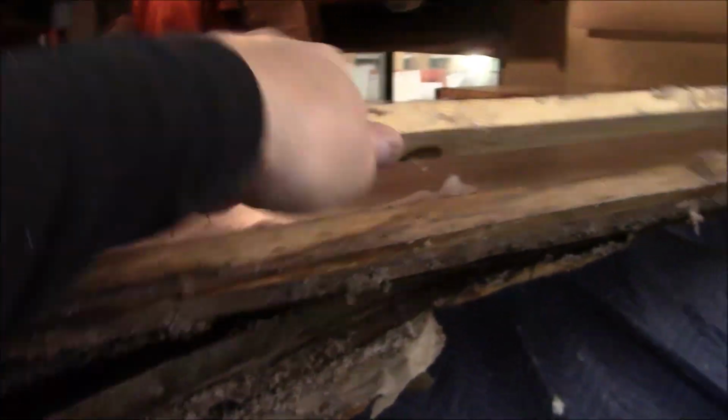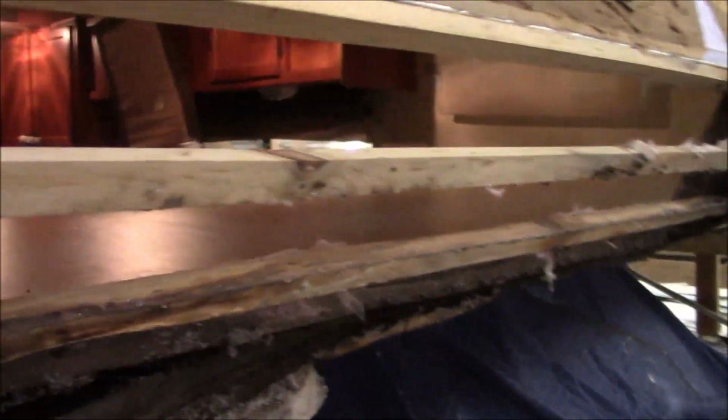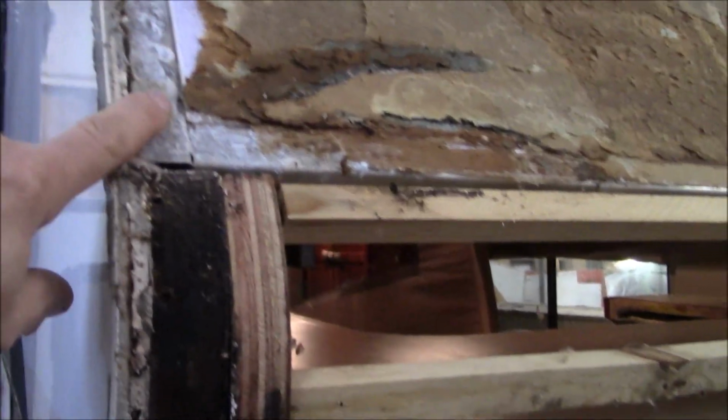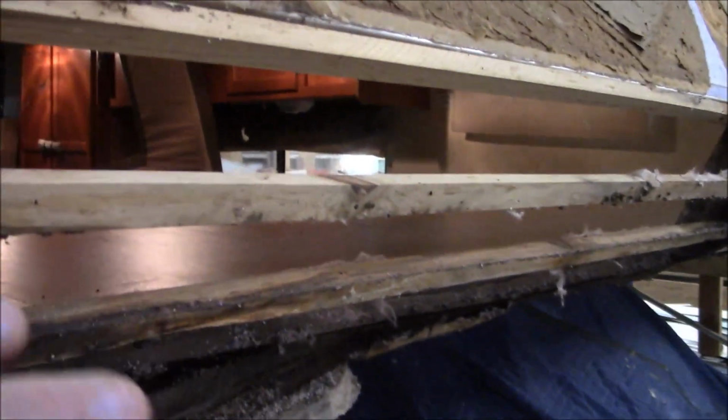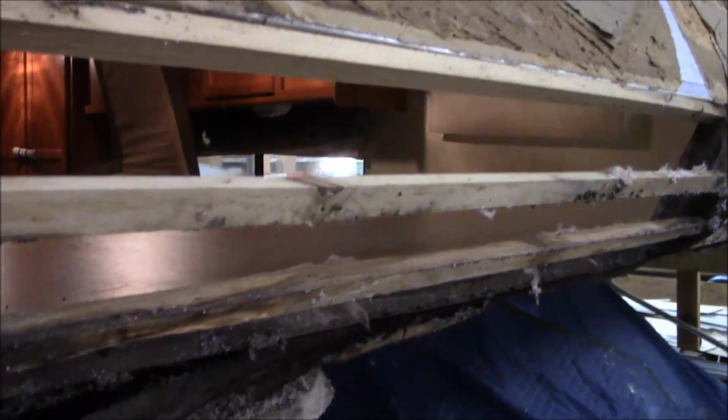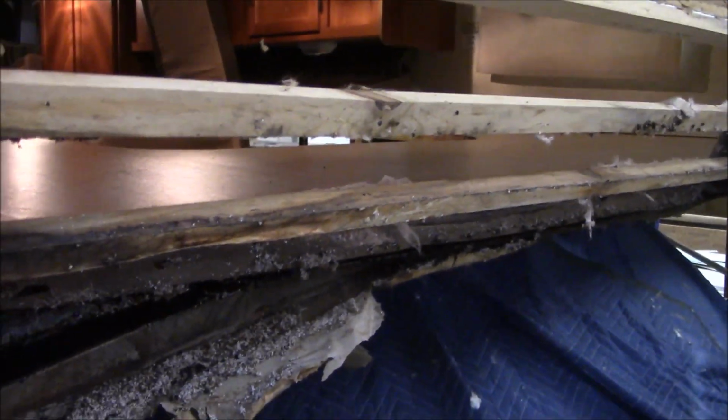All right, so now, like I said, all this was all wet, and then all these are just sticks. See, they just put these in. They just put a staple in them, and what happens is these things kind of move around a lot. When you get that headwind, and they start loosening up, then the caulking loosens up, and then the water gets in there. So they want to try to make these things as light as possible, but you can only get away with being so light before you lose the strength.